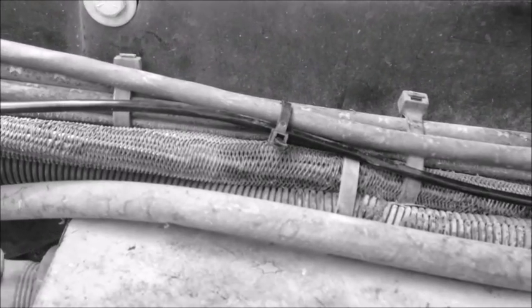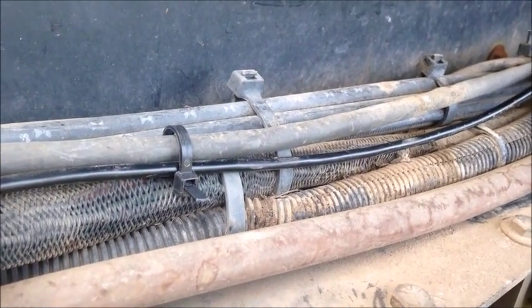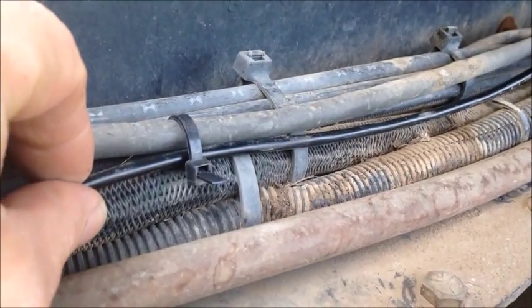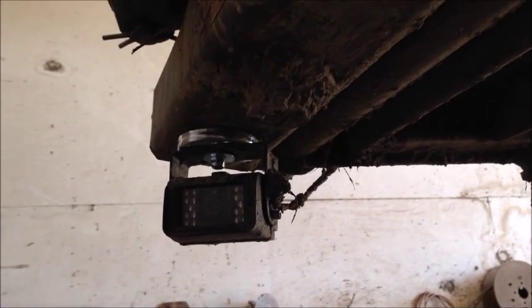In this section we're going to talk about wiring. Underneath the cab you've got the place where most of your cabling is coming in, so find the easiest best way to get inside the cab with the main cable. We've simply zip-tied the main cable to the current cable running along the sprayer, using existing wiring harnesses. One very important thing: where you're running this cable along hydraulic hoses, be aware that hydraulic hoses will expand and contract, so when you put the zip ties on, make sure you're leaving them loose — the main purpose is just to hold them to that line.